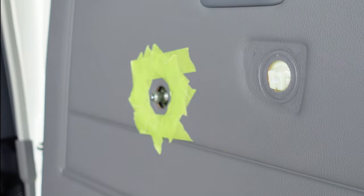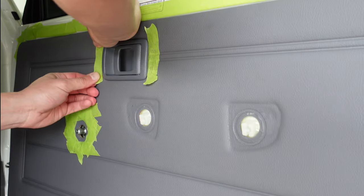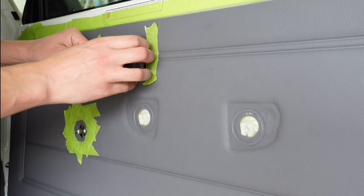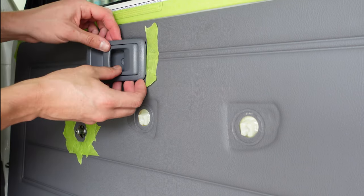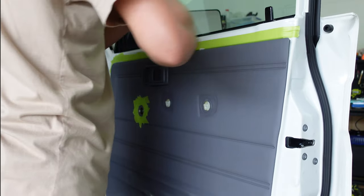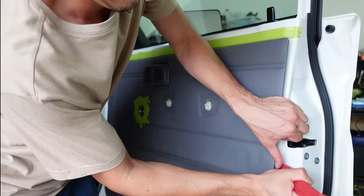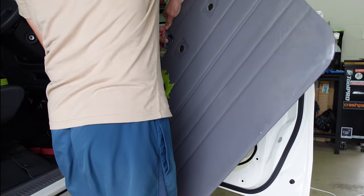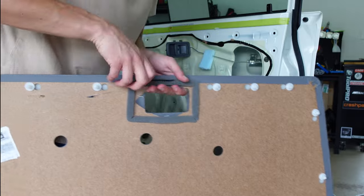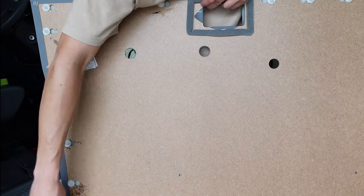As the first time I did this it definitely took me a long time to figure it out. Pop out the interior door handle by unscrewing the Phillips head and sliding the handle towards the front of the vehicle. I love how easy this truck is to take apart and put back together — all you need is a screwdriver, 10mm socket and a pry tool. Next, pop out the plastic retaining clips behind the door card and be sure to pry as close to the clip as possible. Behind these cards is just thin MDF and if you pry on an angle you will damage the board around the clip, rendering that attachment point useless. I then use a spin move to remove the door card, which means I don't have to stuff around with removing the entire door handle assembly. You can see how many clips there are on the door card and their location.